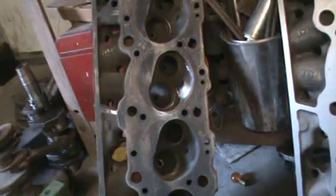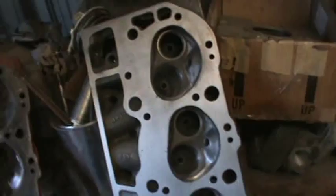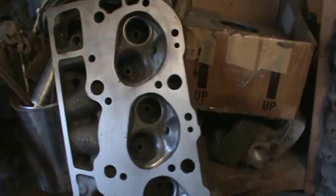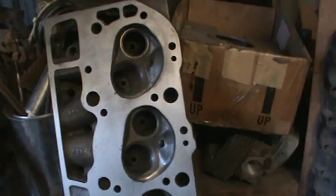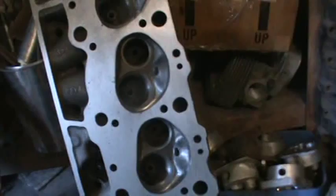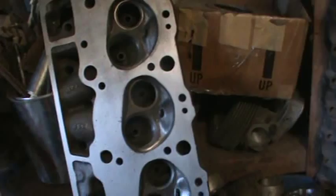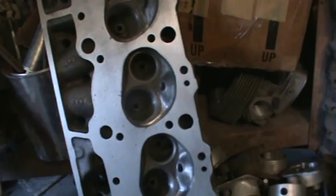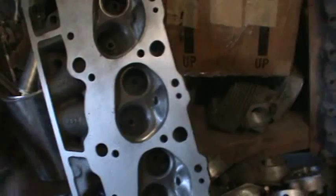I've used these O49s in several cars. I showed you Ron's Nova — it runs 10.60s with street tires and mufflers. It's a 60-over 454 with about a 607-lift roller in it and a 1050 Dominator, and it runs consistent 10.60s with a set of oval ports. I didn't do the heads on Ron's car — a guy named Jim Fitzpatrick, a famous head porter in our town who messes with a lot of super stock stuff, had a cylinder head shop with Ron. They actually spray-welded the intake port smaller and picked the airflow up on those heads. Jim does a lot of that weird stuff with the super stock guys — shrinking the port for velocity instead of volume.